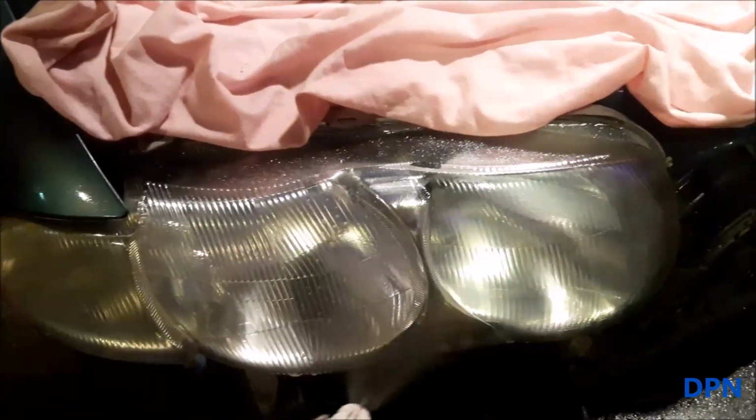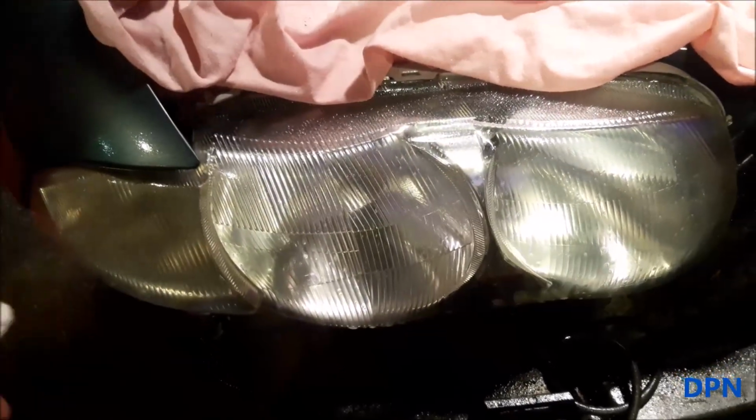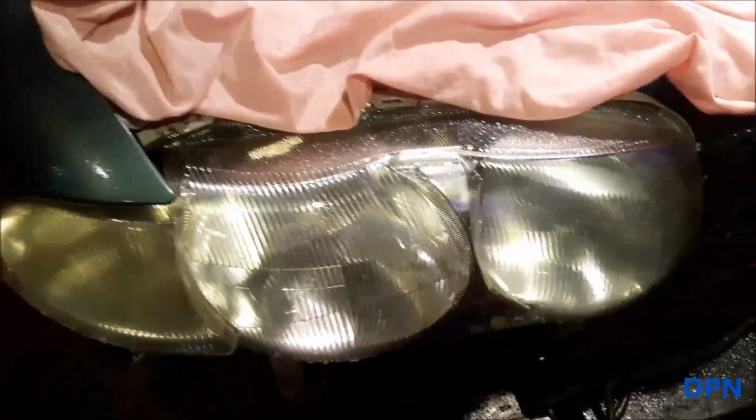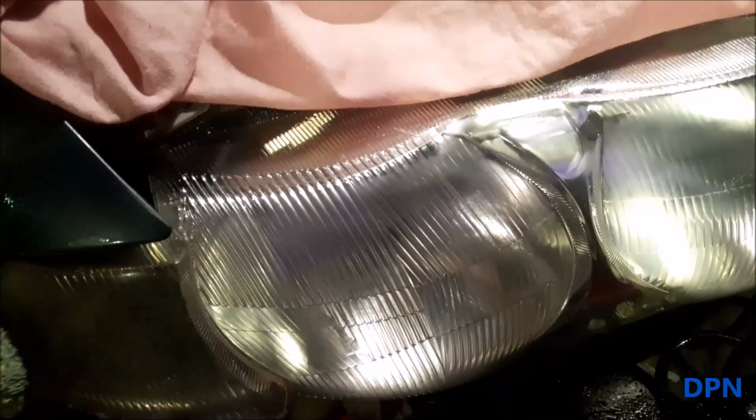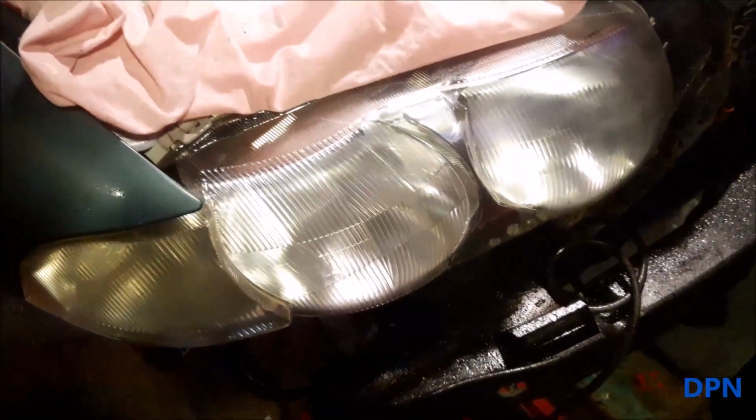Again, what we normally do is give them a good spray of our soapy water, and then give them a little wipe off. Again, that's just letting you check that you've got everything sanded, but also getting rid of any of the dirt and the grit that's coming off the wet and dry sandpaper.